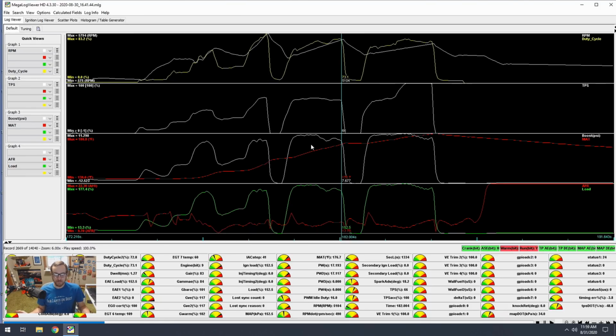The good news is I do think it is actually a better ignition system for this setup. I will say half accidentally, I know I don't have any methanol in the car right now, and that's been a constant, but I also wasn't running the water injection at all currently. So it was a very hot day with no water injection, and I was doing some pretty strong pulls with the thing. And here's the thing, it never broke up. I never had a misfire or any ignition issues on power during any of those pulls.